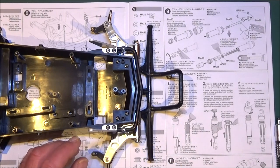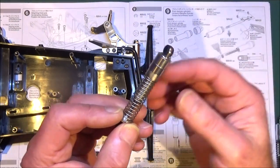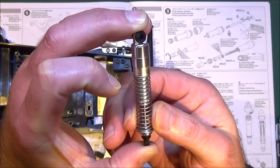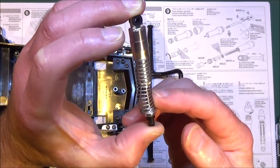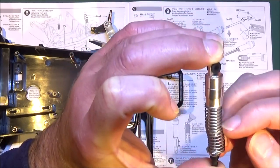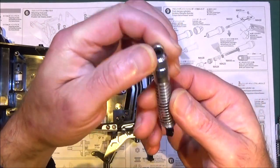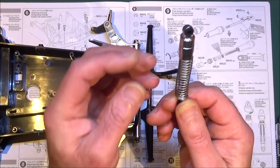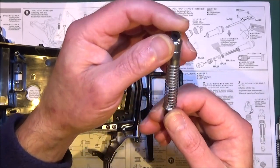Steps nine, ten, and eleven show you how to make the dampers up, and I've followed the instructions to build them stock. There is a little problem: the bottom shock mount cap doesn't hold the bottom of the spring properly, so it moves around, gets twisted, and can catch — it rubs away on the body of the shock, and as it's aluminium it gets scuffed up and makes a horrible scraping sound. There's a really easy fix for this that Adam from Adam's Playground shared on his channel — I'll put a link in the description. His tip is putting an O-ring around the top of that little silver retaining clip.